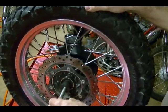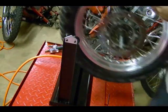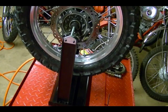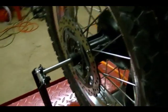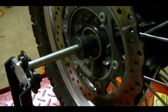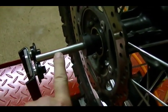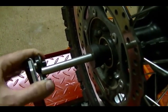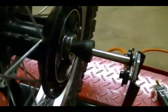Once you have that in place you can take your rim and place it on the balancing stand, like so. This is how the rim and tire looks once you have it set up inside the balancing stand. You can see how these centering cones fit inside this bearing. This axle is part of the balancing stand, it's not the axle from the bike, and you can see how it fits into these wheels here on the balancing stand. And here's the other side.